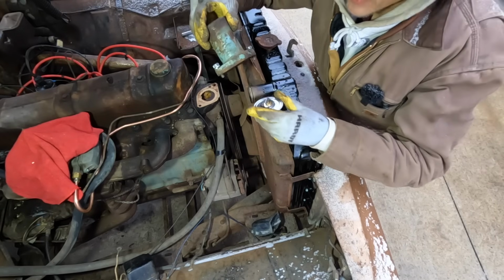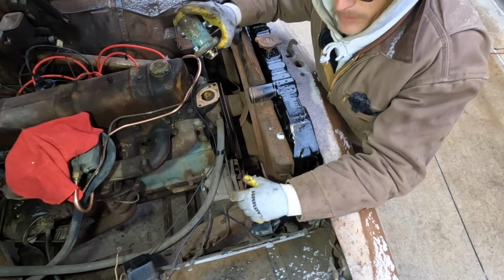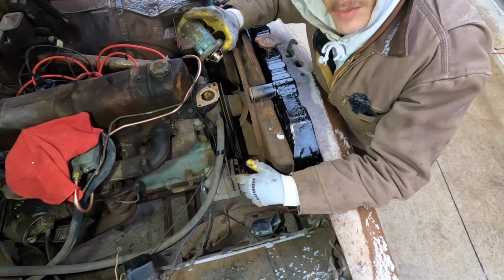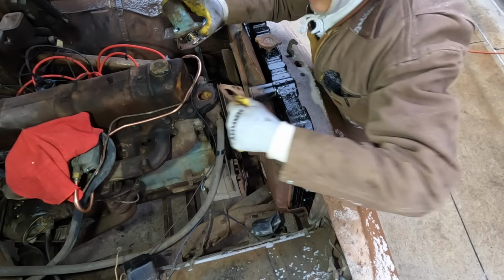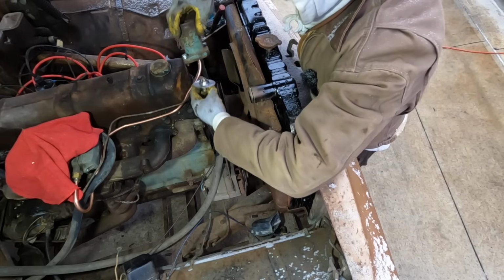Now, you can test your old one by just throwing it in a pan with some boiling water in it and watching the spring open and close when it comes to temperature. Hopefully you're not using your wife's good all-clad stainless steel pan, but an old pan. See if it opens up. Test it out. But they're so cheap, they're only a couple bucks. Just grab a new one.